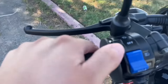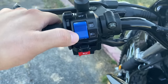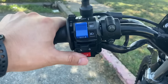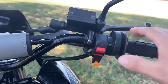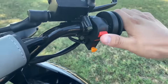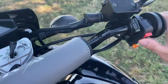On the controls, you have your on and off switch for the headlights, your high beam or regular running light, and a flash option to flash your high beams. You have a left and right signal light switch, and a horn. You also have a kill switch on this side — make sure when you start the bike it's not in the on position. Always have it in the off position, because a lot of people get that confused. If it's in the on position, the bike will just turn over but not fire.